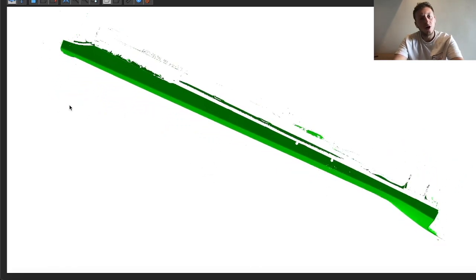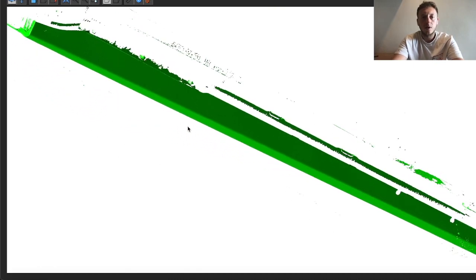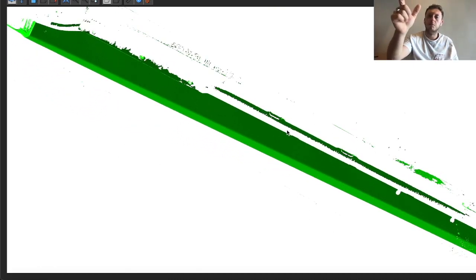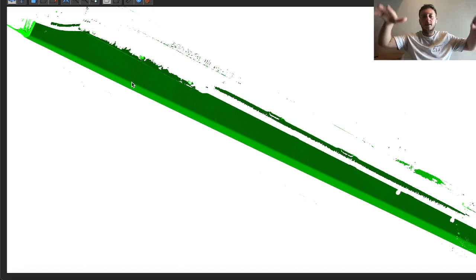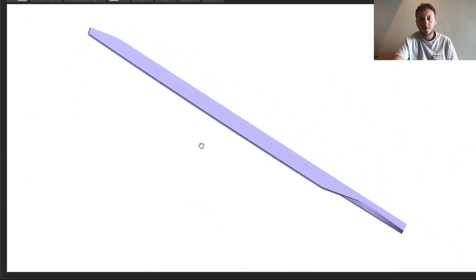this? There are no hole positions along this section of the side skirt, which is a bit of a shame, makes things a bit difficult. But there are some 10mm sockets along the back here, but the distance from the 10mm, for example, to this front face is too much. When you stand on the side skirt by accident, it's going to rip it down and things like that. So let's have a look at the design and figure out what MHC have done about that.